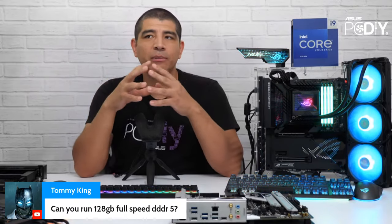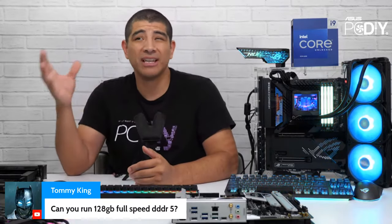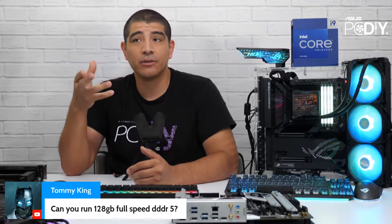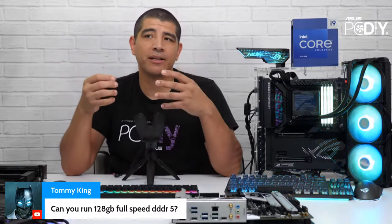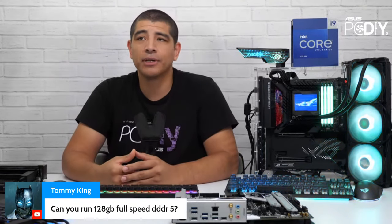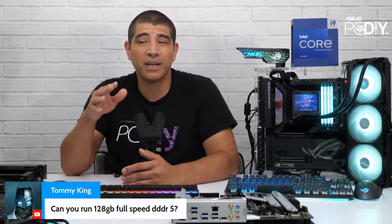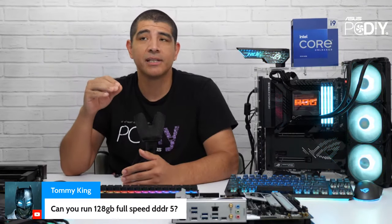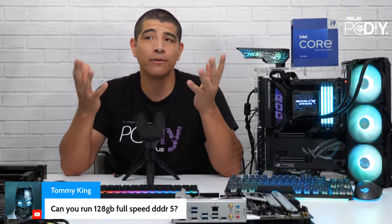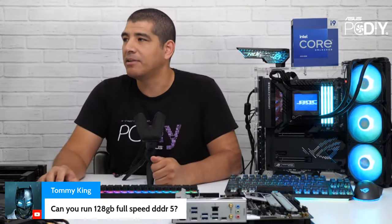I'd probably have to spend a bit more time double checking with our team. That's not a configuration we normally test as much, because it's not as common in a more professional environment. Users aren't as critically focused on bandwidth and frequency as they are on density and reliability. That being noted, there's an interesting balance where you can run higher frequencies and still get very good reliability and high density with DDR5 in 64 gigabyte configurations. My initial expectation is that you should see a more comfortable range of maybe 52 to upwards of about 56. But keep in mind, those are non-official, overclock configurations, because there are no overclocked 128 gigabyte kits. You're buying two kits of memory, combining them together, and you have to manually set the memory divider.